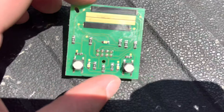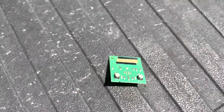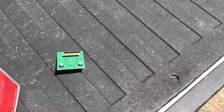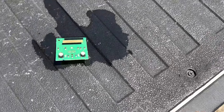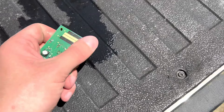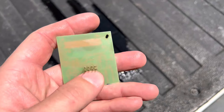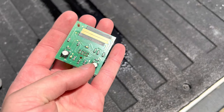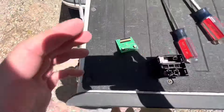This board doesn't seem to have any corrosion, so what I'm going to do is just take some 91% isopropyl alcohol and soak this board, then clean it with a Q-tip or my hands. As long as this isn't plugged in it shouldn't damage it. Work these buttons, clean that up, and definitely let it dry out before you plug it back in. Since it's about 100 degrees out here that's probably good enough to dry up.